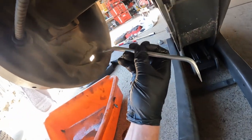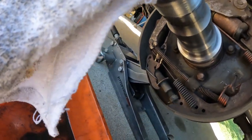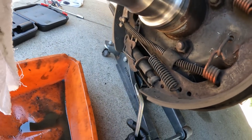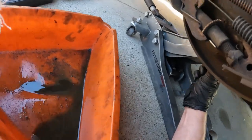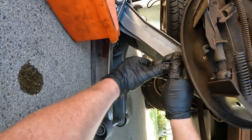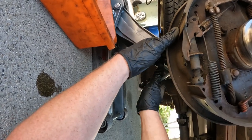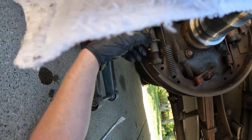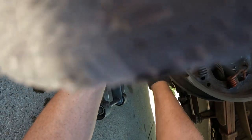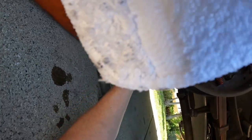There's a hole in the back side of the backing plate that allows you to go in and turn the adjuster roller. To take the tension off, come in through the hole in the back. If it's clicking and sounding like it's turning really easy, you're going the wrong way — you want to be fighting the pawl. That'll bring the adjuster in and the brake shoes will come in. On this side, you would be moving the handle down; same thing on the other side, handle down turns it in.